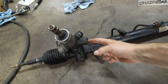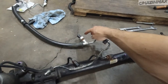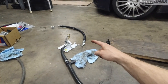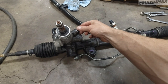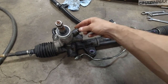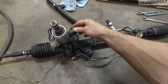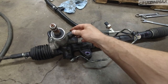You've got two lines going in. This is the pressure line over here — easy access. This is a 21, I believe, which is this line here with the sensor. If you're replacing this pressure line, you're going to have to take this old sensor and put it on your new line. You're going to be able to get in there with your regular wrench. This line — that's the nipple — undo the clamp; I believe it was a 10mm or a flat screwdriver. If you're lucky, the screw on the clamp will be pointing out this way — easy access. Take the rubber hose out.